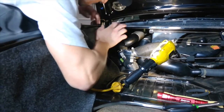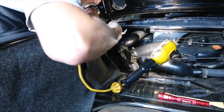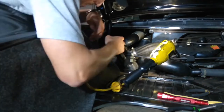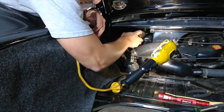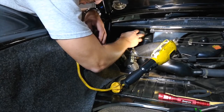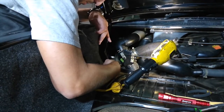Also, one last thought. The best part about this whole repair is that if you have the right tool to get in here and extract the nozzle, you don't have to mess with potentially tearing or damaging these nearly 40-year-old paper and aluminum hoses. And just generally kind of going crazy disassembling stuff and putting it all back together. There's a lot of tightly packed stuff in here that you don't really want to mess with.